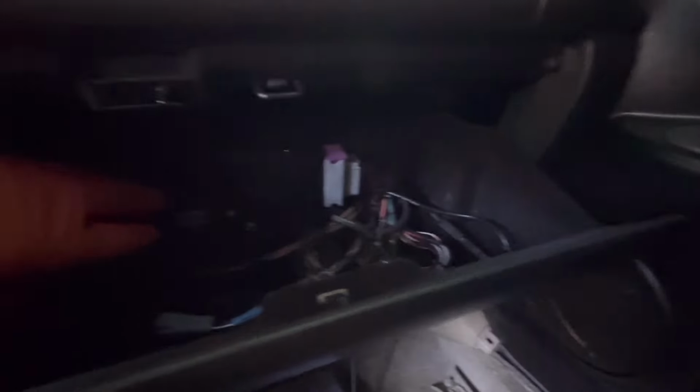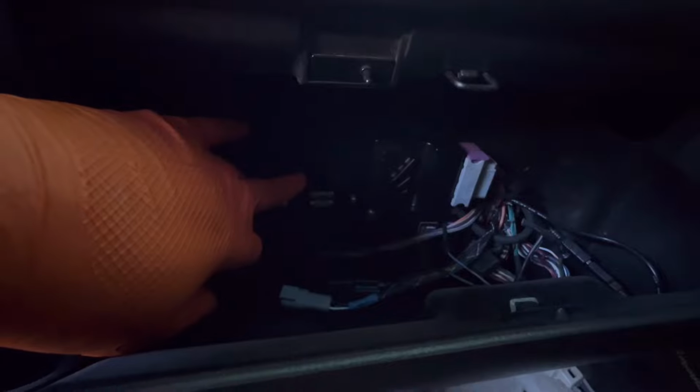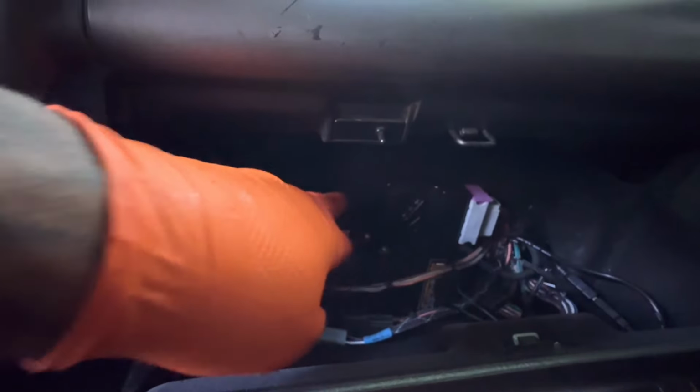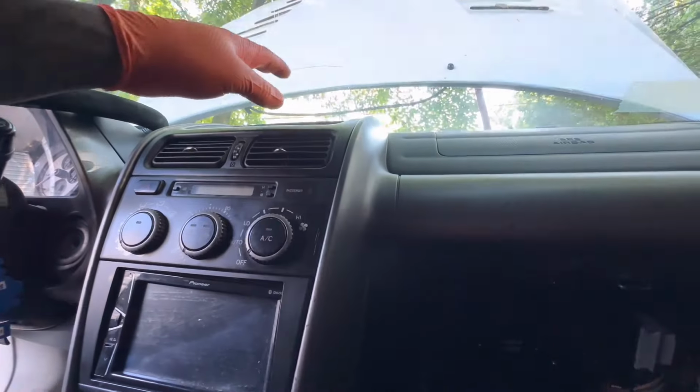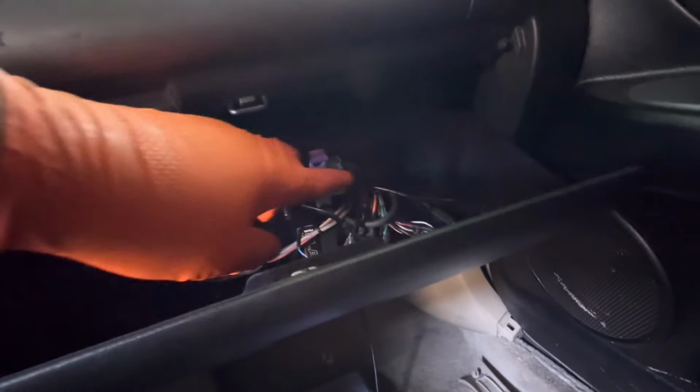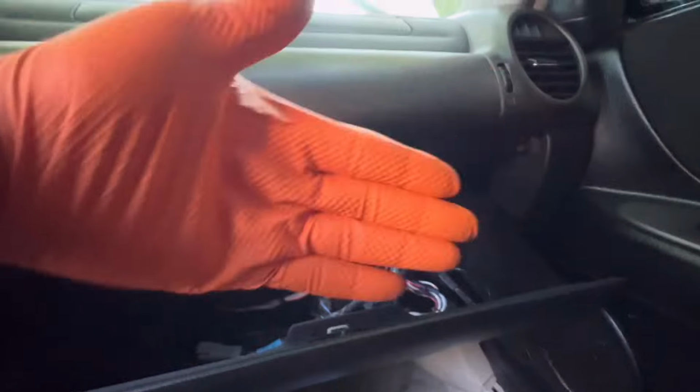Let's see. Just want to show you guys the ECU. Oh dang, you can't see it, but ECU Master Black. This is running the stock IS300 coil packs, but this is the igniter. Tweak hooked us up with the wiring though. Instead of sitting in the original location with the ECU, we actually fished it through the firewall to the dash. You can't see it, but that's actually an intercooler coupler. I cut it in half, laid it flat, and just cut an X in the middle and fed it through, so that way no water or anything can get in here.